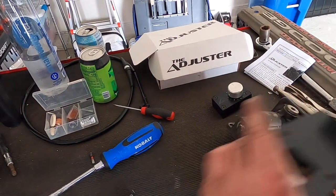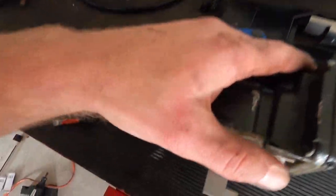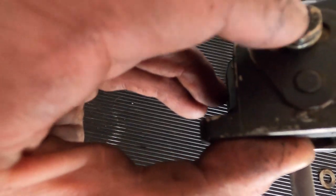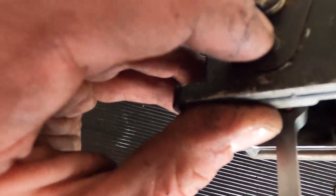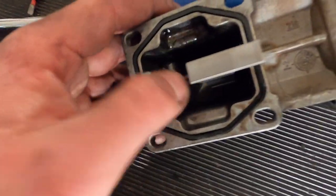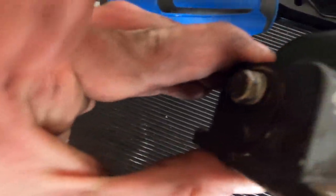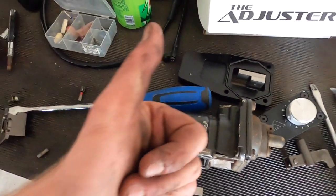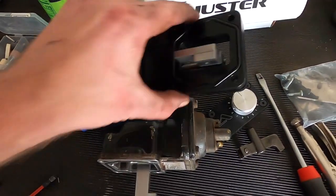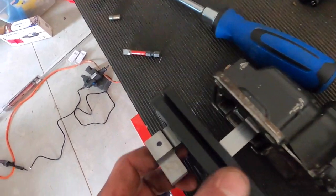On the AFC housing you have to replace this arm. To do that you just remove this small bolt on the end, slide this black piece out of here — it takes this bar out — and you can put the new arm in after that. Tighten it back up and now it's ready to go back in the truck. This goes underneath it, something like this.